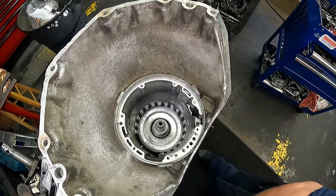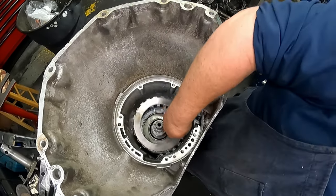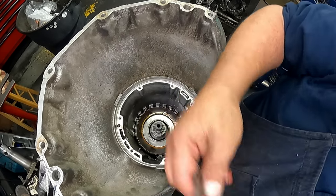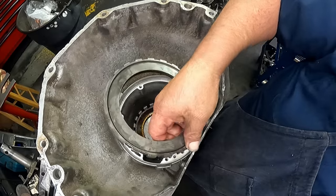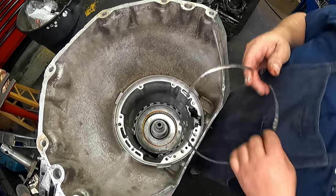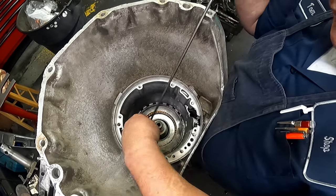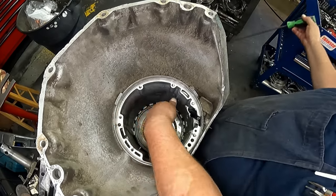Okay. Now, wavy steel, I always put the notch at the 6 o'clock. If there's any other notches, go ahead and put them down there also. Put your pressure plate in with the step up, and I put the opening over here again. I would also recommend that you put the Torqueflite 727 forward or front clutch drum snap ring in here. It fits much tighter and it helps keep from blowing them lugs out.